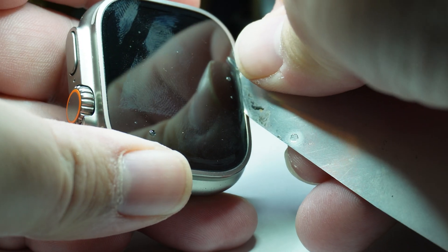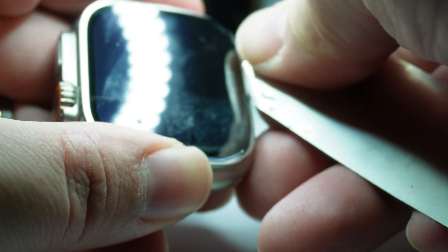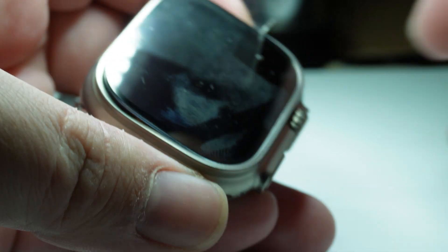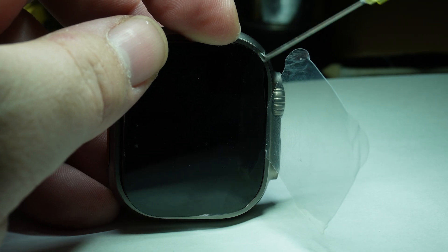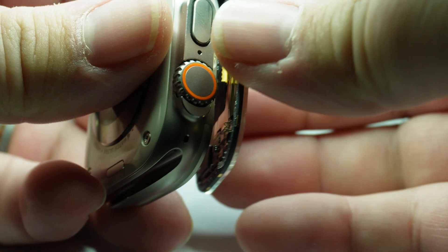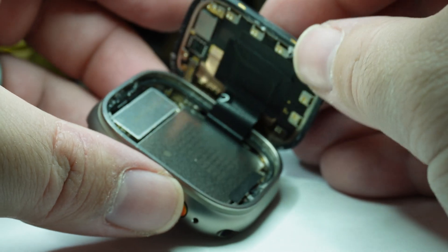Eventually you'll feel it kind of release a little bit. Take the tool again, stick it down inside, and lift. What you should see is a separation of the whole display — frame, glass, everything should come up at the same time. Get your fingernail under the edge and continue with the plastic down and around. We just need to make sure that we don't go too deep on this side, otherwise we'll clip the flex. Add some more isopropyl alcohol to help the adhesive split away and it'll open up. We'll add a little bit of isopropyl alcohol on the back of the display flex and gently peel it away just a little bit to relieve the tension so we can take a look at the inside.